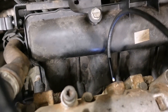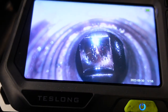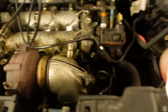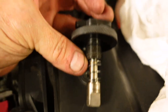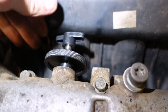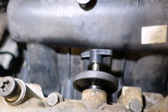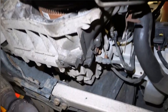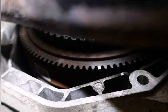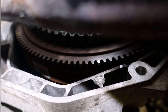I've moved the crank - taken the locking bolt pin out and moved this so that it is in a more centralized position. I'm pretty confident that the tool will fit now. These wee wings won't turn because the flats are in the notch in the cam. It doesn't go in that far but you can hear a wee click. With our cam locking pin in - one, two, three, four - four teeth out on the flywheel.